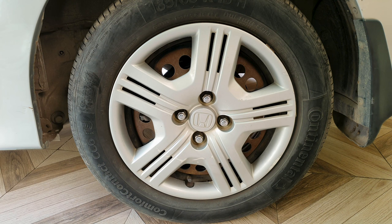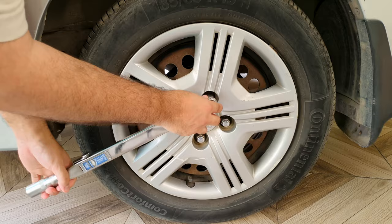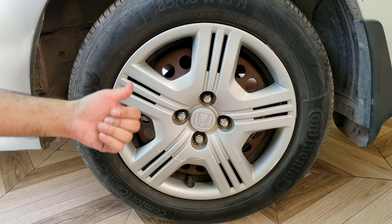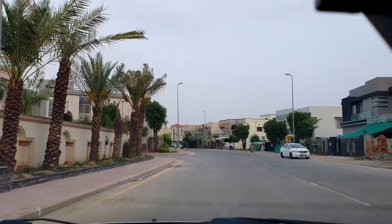All Honda lug nuts are to be tightened at 80 pound-foot. Move on to the other side once that's done, then press the brake pedal a few times and engage the parking brake. I've tested light, normal, and heavy braking — the noise is gone because of the adjustment, and braking itself has improved.